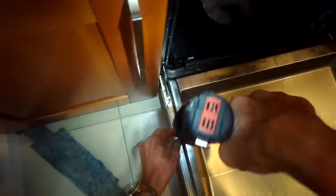Now we're going to put the new motor in. I'll slide it in below that panel, get it in position at 45 degrees toward me initially, then push it all the way in to seat it inside, then push the motor away from me so it goes vertical to the 12 o'clock position. To get a better look, I'll remove the front panel from the dishwasher by taking out the Torx 20 screws along the perimeter — that lets me pull the front panel off. You don't have to remove the door, just the front panel, which gives a lot more room to work and lets me show you how the motor goes in.